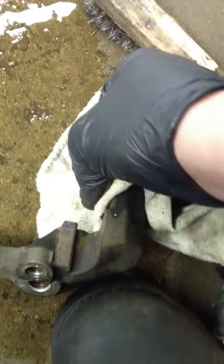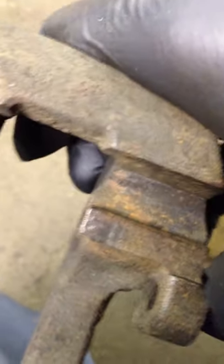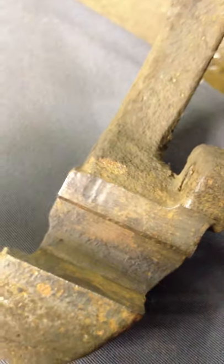You're going to want to wire brush the caliper bracket — where the pads ride. Just a regular wire brush, get in there. Then brake clean — get your fingers in there, get all the scale and grease out. Something like that — not perfect, but not overly. Clean up where the rust is going to affect pad sliding action.